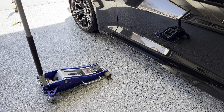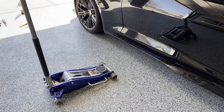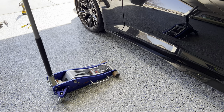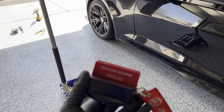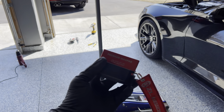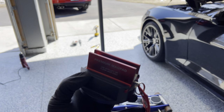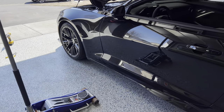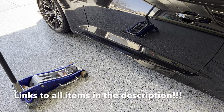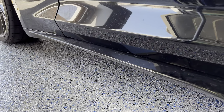When it comes to the lift pads, a lot of people ask, how do you initially get the car lifted to put the lift pads on? The easy answer is using a pinch weld adapter for your jack. I have a ZL1 add-ons premium mag pad which includes the puck and the mag pad itself. This just slaps onto the pinch weld. That'll lift the side of the car up and then from there we can attach the lift points both front and rear. There's a nice midpoint to lift the car from.